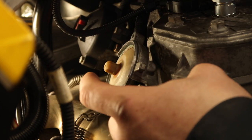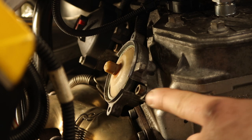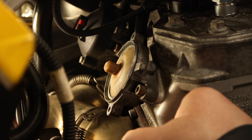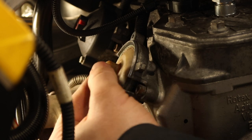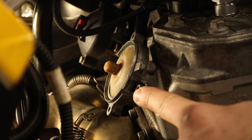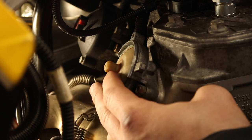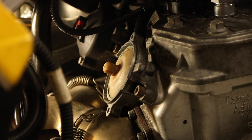As long as it's moving freely and there's no leak when you blow on it or vacuum it, your rave valve should be functioning fine. There's no reason to remove it unless you suspect carbon buildup. I know there's not on mine because I just had the Y pipe off this motor and could see them. If you're having issues and it's not sliding correctly or it's stuck, then you can take your allen key and dive into it. But the whole point of this video is just to check them without pulling any gaskets — just a yearly inspection.